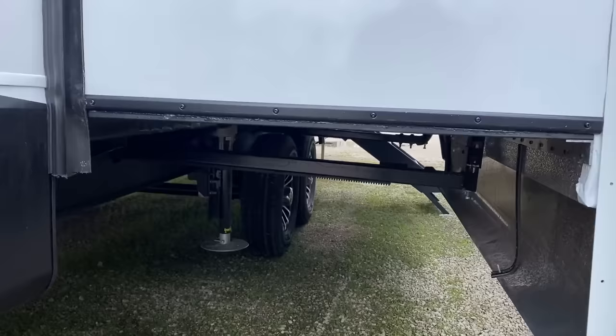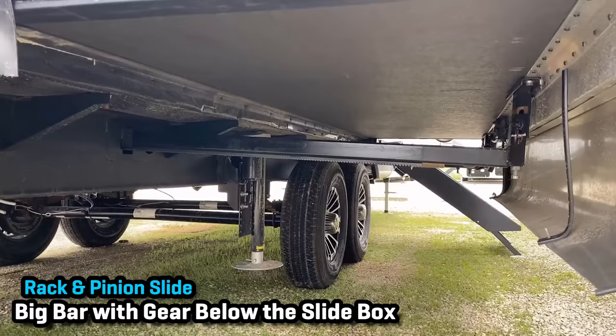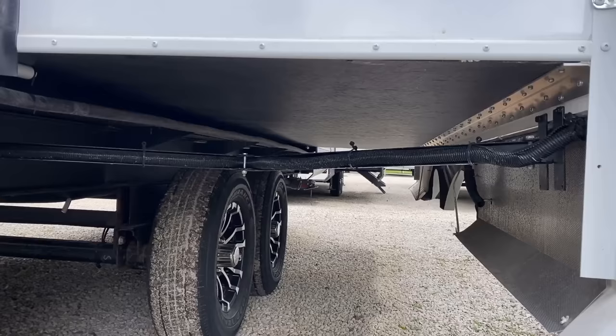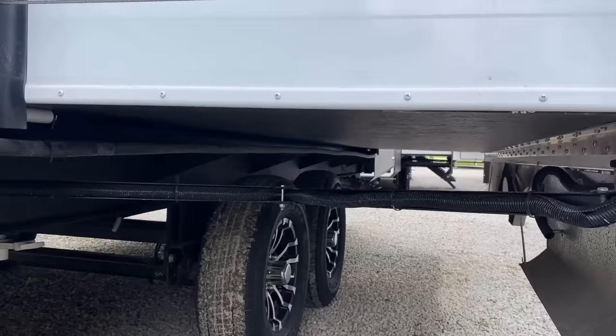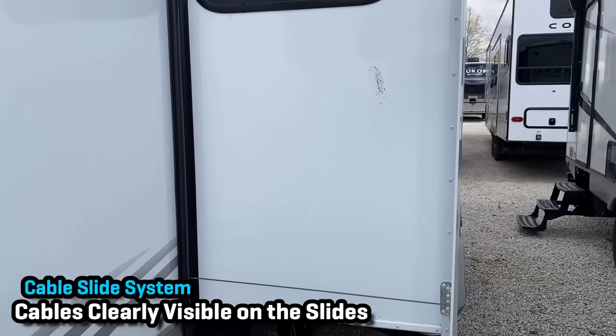The first one here is called a rack and pinion slide, and you can kind of tell that because it's got this big old ram bar system that goes underneath the slide. Now, shifting gears, don't let this fool you — what we're looking at now is not the same kind of ram bar system. This is basically just a guide for wiring that goes through an RV slide. We've actually changed over to a cable slide, which is very easily identified by the fact that you've got a couple different cables hooking up to the outside of this thing.